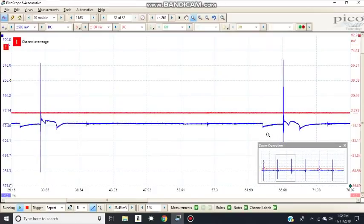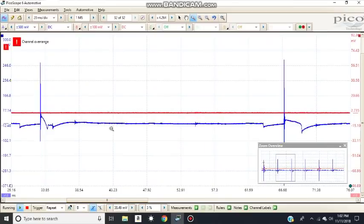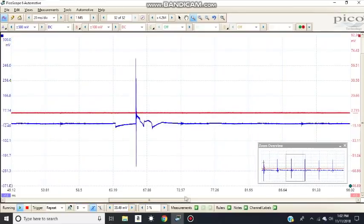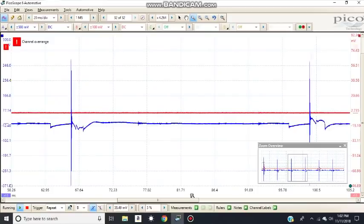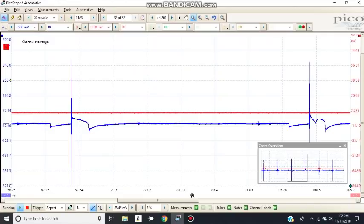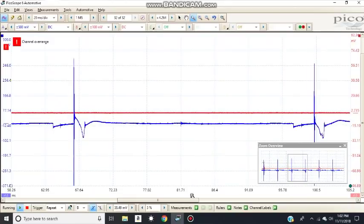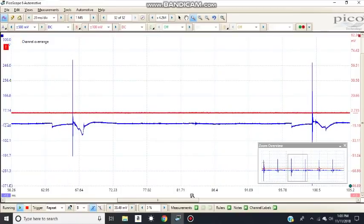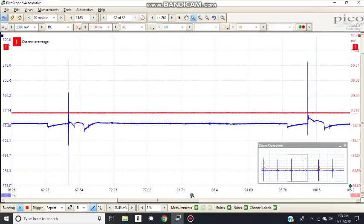The power KV is pretty stable, it stays the same. But there's still a lot of noise in the burn time. But you know, the car runs fine now, so it was okay even before the tune-up, but I was expecting a little bit better signal, but it is what it is. Maybe in this car it would be better to take the coils out and put the adapters in and try to get the ignition waveform free from the spark plug.